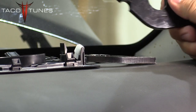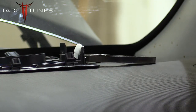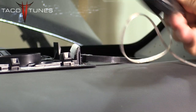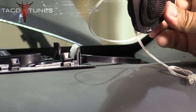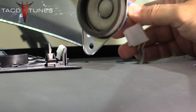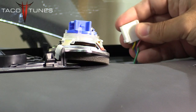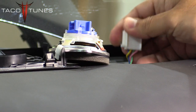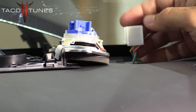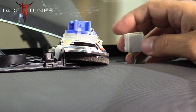So our first challenge is overcome — we can install aftermarket tweeters. Here we're going to be installing this set of tweeters, already attached and not going anywhere, so we can just bolt this in. When we remove the stock tweeter from its harness, there are actually four wires running to that one speaker. The reason for that is Toyota wired this speaker and your front door speaker in parallel.